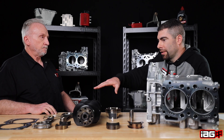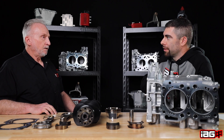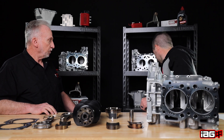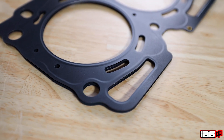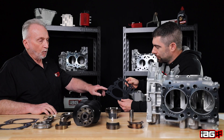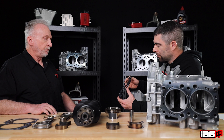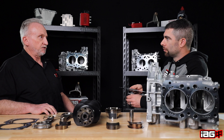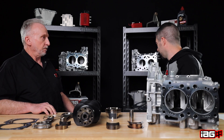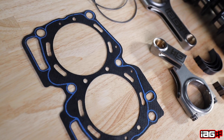What is the difference in the gasket we're using versus the gaskets used in our other stage blocks? The other gaskets are a multi-layer steel head gasket that has been embossed with what we call a fire ring around the cylinders, as well as some other areas, for sealing water and oil passages. They're multi-layer — anywhere from three to five layers depending on the brand. It's a perfectly fine sealing system, but once we start moving up in power, we need to upgrade, and this is the next step in that process.